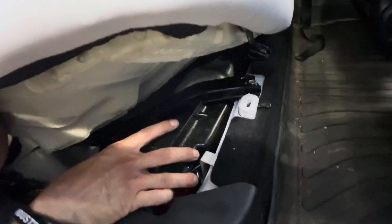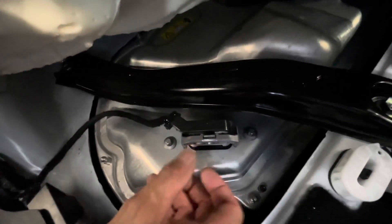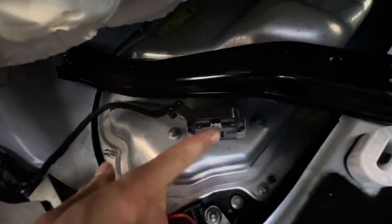So now we are on the rear passenger seat. There is a little tab that you have to push away from you in order to release the seat. Just pull that little tab and push it away from you — your seat will come up and you're going to have to hold that up. Then you see this foam block — take that off, remove it, put it to the side. Here is the high voltage wiring connector. Pull that little gray tab, push it downwards, then wiggle that plug off and pull it right out.